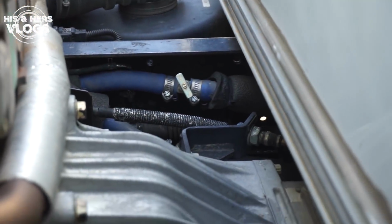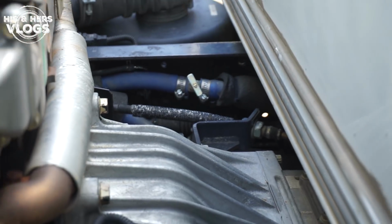There's 2 valves right down there. You close both of them and it shuts off the hot water to the camper. Now keep in mind, this is also shutting off our hot water heater. But the hot water heater holds heat for 2 days. So we're thinking what we'll do is we'll drive, for example, for an hour, or maybe the first fuel stop for a day. Then we'll close it. So when we stop for the night, when it's hot, we won't have all that residual heat.